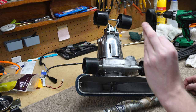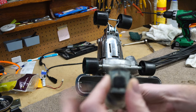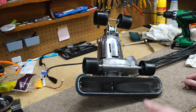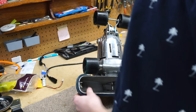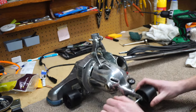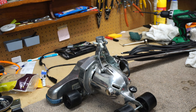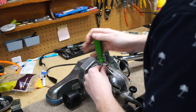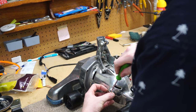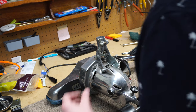First of all, this belt is shot — that's a style eight belt. This is an older style with sleeve bearings, and you can see the end caps on there — real cheap stuff. The Royal is a lot simpler to make than a Kirby. They did make models with detachable face plates, but this is not one of them. The cool thing is I can check the carbon brushes without taking the machine apart.